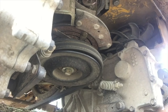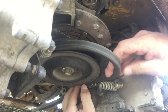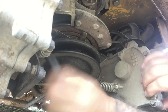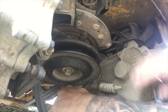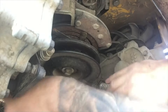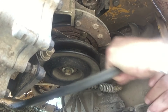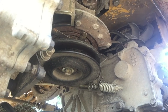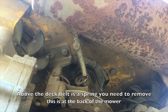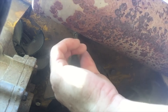Here's the spring — it hooks in right here and then it hooks in over there, and that loosens up the belt. So once it's loose, you can just pull it. It might be a little bit of a squeeze, but the belt comes off. Right here is the spring that goes to this belt tightener for the drive — it's connected to a bolt and it goes through a little loop right here.